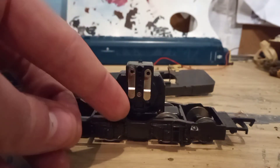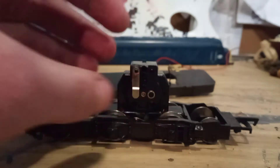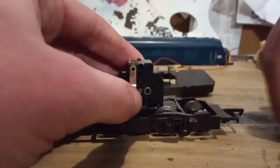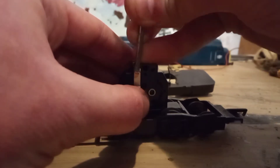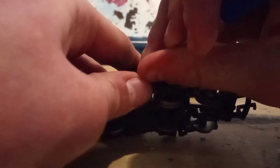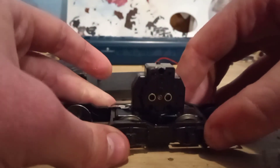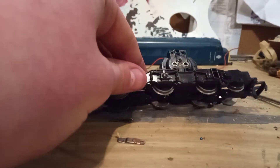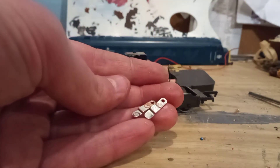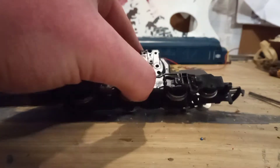Now I've got to remove the other spring and the two brushes. With the screws removed, these panels just come off. The plate has actually fallen inside — I'll get that in a minute. The other one comes off too, but because this is Mainline you might need to pry them off. And as you can see there's no spring visible because it fell out — this is why I say always be careful of the springs. The caps have also fallen out — these are what hold the spring and brushes in. We need to clean those too, so they can go to the side.